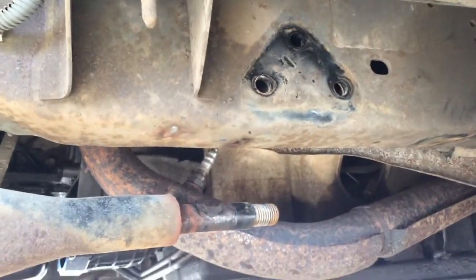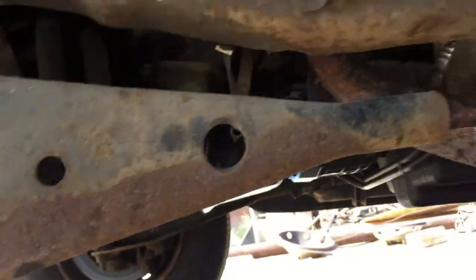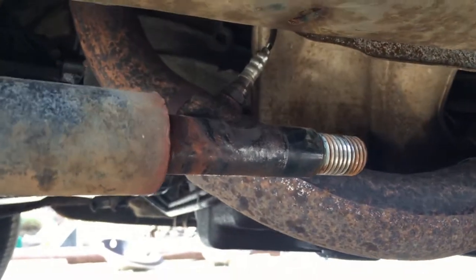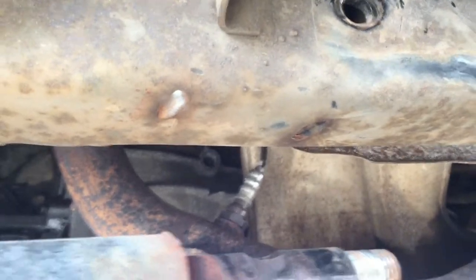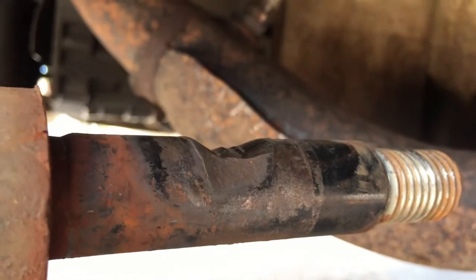We are working on our control arm bushings. Here's the rear of the control arm on our Ford E350, and here is the piece we just took out. You can see there's some previous damage — look where the metal bushing was hitting the frame. You can see where that's worn out, and actually I think that's damage to the control arm itself, worn out from the bushing. I don't believe that comes from the factory like that.